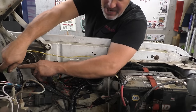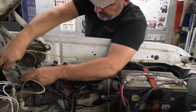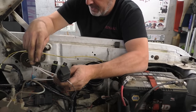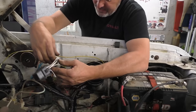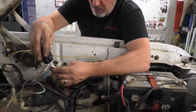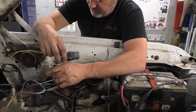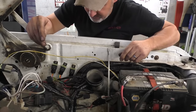These terminals were all clean. I had power where I was supposed to, key on, engine running, all that. So I just stuck it in there. But like I said, I don't know if it's applicable to this transmission. And then this relay here, I'm just going to verify if it is wired correctly. If it is, we're just going to leave it, because it's the wide open throttle unlock solenoid for the AC, which I doubt the AC even works. So even though it looks out of place, there's no sense in really making a mountain out of a molehill when it comes to that.